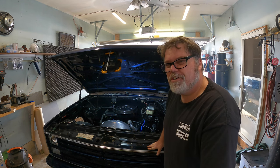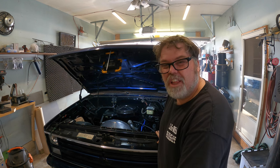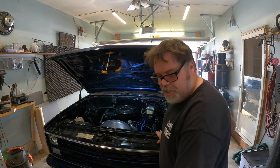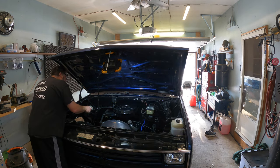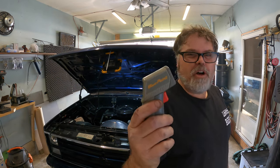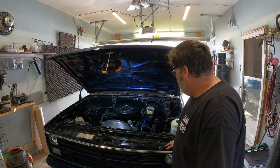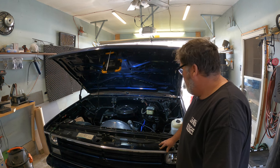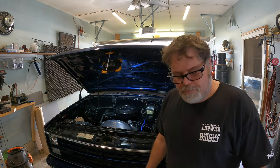That'd be all right. I put some high test in her today - $30 for not very much. That old girl sounds pretty good for 400,000 kilometers, not miles. We're firing all eight. So maybe tomorrow we'll get the truck out of here and take the fender wells off - we'll need to get them swapped back in this week. Now that we've kind of done most of the tune-up, still going to change the oil. So we've got new plugs, new distributor cap, new rotor, and wires - I checked them with the meter and they're fine. Don't forget to subscribe if you like and hit the notification bell. Glad you're all here, welcome any new subscribers to the channel. I love you all, and until next time, you know what to do.